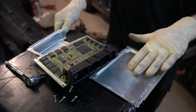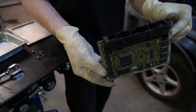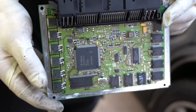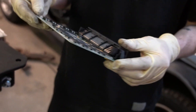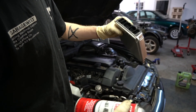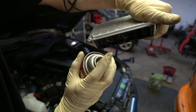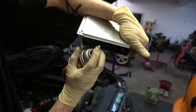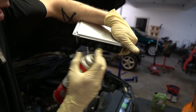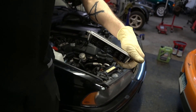That's how to basically diagnose and remove a DME and check it for any kind of physical damage. If you didn't get to see what we were looking at for the terminals when we were inside the car — you can see all that bluish-white corrosion. I'm going to send some pictures out to my computer guys and see what they have to say, but I'm pretty sure we're going to be programming a different DME to this vehicle. I got the DME back together — this car has to go home and it's known to be working at least a little bit. So what we're going to do is take some electrical cleaner and just spray down those contacts. We're not going to go in there with a Q-tip or anything, but we're just going to spray down those contacts and hope we're doing something. Even just unplugging and reconnecting should help a little bit — shake out any excess, let it dry before you do anything, and I'm just going to spray some air in there.